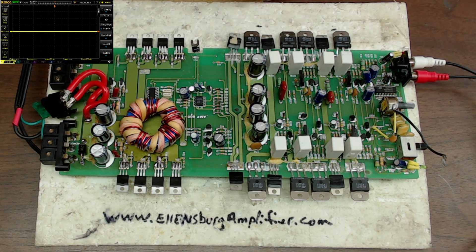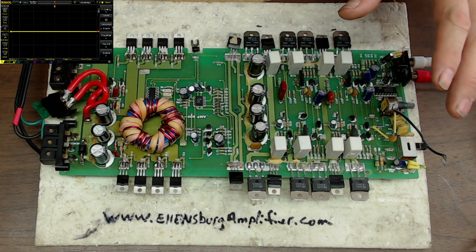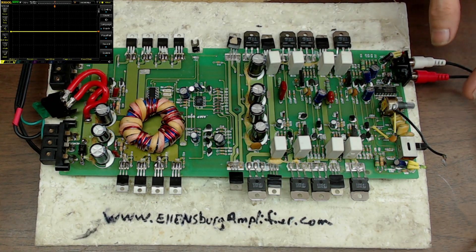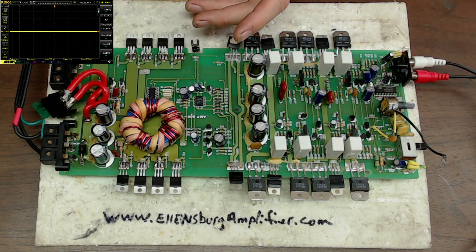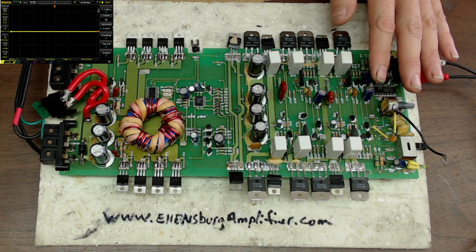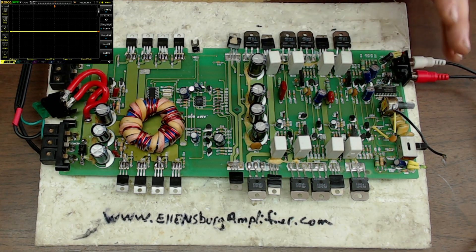At the end of that video I had shown you that the input signal and the gain — you could turn the gain just a slight turn and go right into clipping. I use an average of a 2 to 4 volt input signal, and a lot of head units now are higher voltage. I believe these earlier amplifiers just weren't designed for today's high-voltage head units.